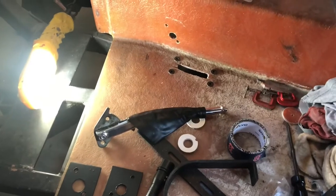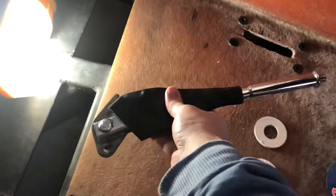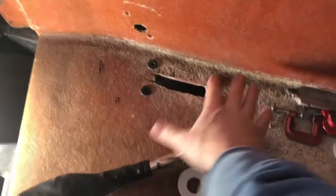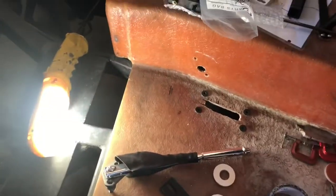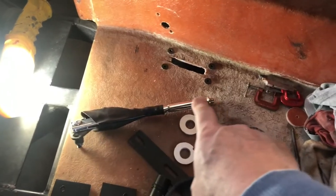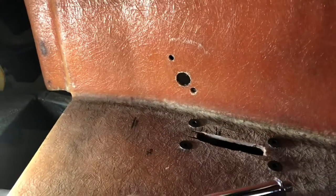I'm changing out the handbrake for this more traditional style — this is from an MG handbrake, more appropriate for the Cobra. I've removed the base of the regular floor-mount style. I'll need to plug up that hole in the floor. There's the driveshaft safety loop — I'm going to attach one of the brackets for the handbrake cable to it. The cables are going to run right through this area, and I've drilled a couple of holes in the tunnel for the handbrake.